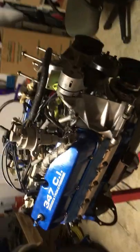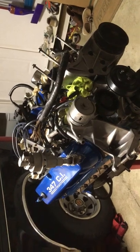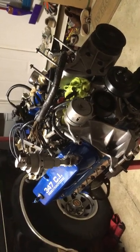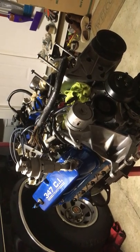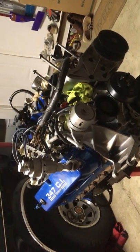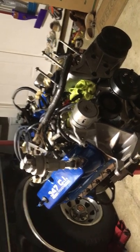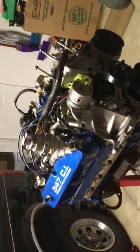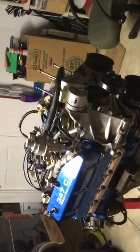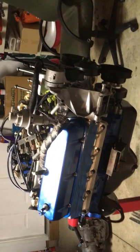It's kind of a long explanation, but the first and foremost thing I can say is that whenever you're building a motor, you need to have some set parameters and set goals. For the Ford Bronco, we're probably not going to want this truck to run nines or tens in the quarter mile. My specific goal was to have about 350 horsepower and be able to turn 35-inch tall tires, so a lot of the applications in a Jegs catalog are not really truck-applicable.